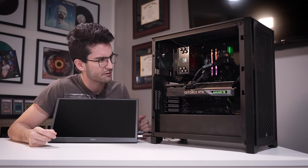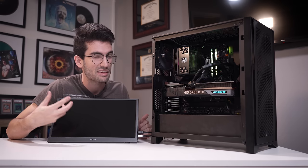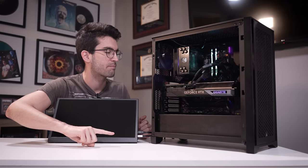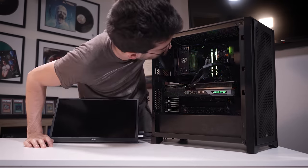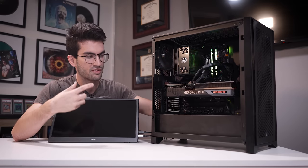I noticed the fan curve is not ramping down at all, so that tells me it hasn't even tried to post, and it's probably not a video out problem. I think I'm going to clear the CMOS first. I'm gonna check RAM seating because I do think, yeah, we're getting the DRAM LED. We'll make sure that's okay. We'll try a single stick of RAM from a working kit that I have to rule that out. And then I'm gonna jump straight into the CPU because if this is a BIOS compatibility issue, like I said, it's gonna be a very quick fix.